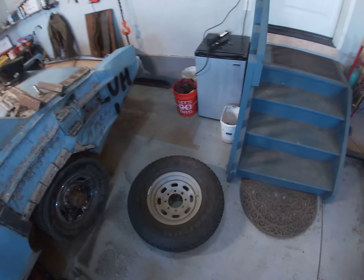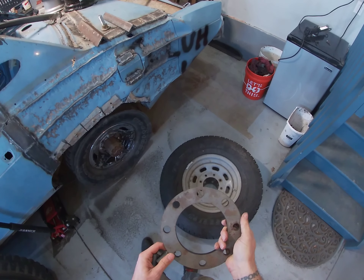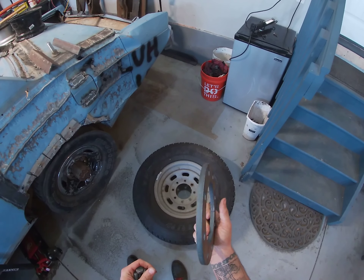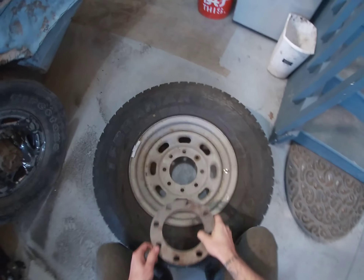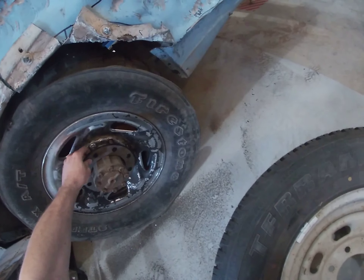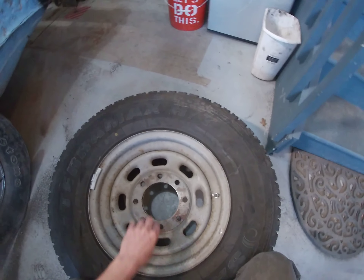Here's the spare and here's the plan. I bought one of these wheel centers a long time ago because I was experimenting with this eight-lug rear end — I wasn't quite sure what bolt pattern I had. I bought this one, and this one is the newer style eight-lug pattern. My truck is an '03, so this will not fit — this is the old style bolt pattern used by a lot of Chevys and GM, Dodge and Ford. This is the newer style one, and this one fits perfectly on my spare.